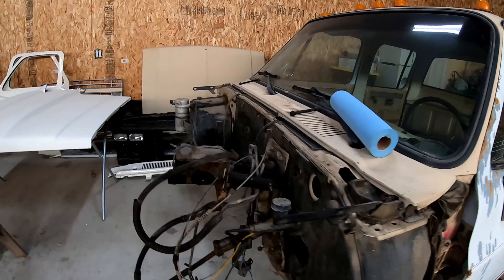The chassis is rolled back in the shop, got that tucked over here. I want to get the chassis done at the moment, so we need to take off all these lines related to the fuel system because we'll be doing something different there. We can take this off because I'll only be using that tank over there. I also have a 31-gallon blazer tank that I'd like to put in the back if I can, and then I'll have the back one and that one. I also have some frame plates coming to box in the frame — I want to get it boxed down here a little ways so it'll be a little bit better for the power we'll be running.